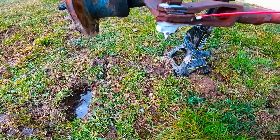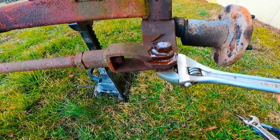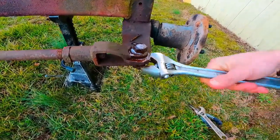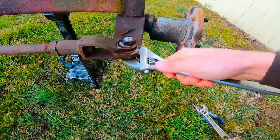If you've missed any parts of the baler series, be sure to check that out. We've got everything all torn apart, knotters are all torn apart waiting for more parts - they should be here this week so we should be able to get this thing out hopefully by this weekend. I always like to work the wrench back and forth because I feel like that really helps - number one, not break anything, and it loosens up all the junk and dirt in there, especially if you sprayed it beforehand.